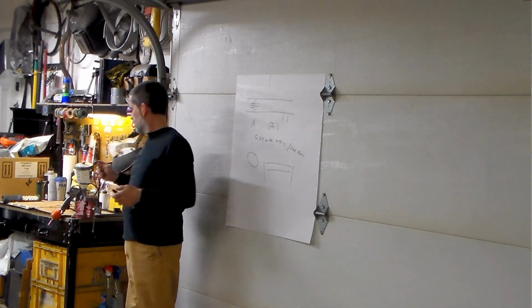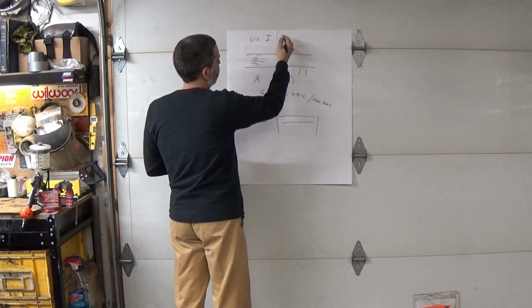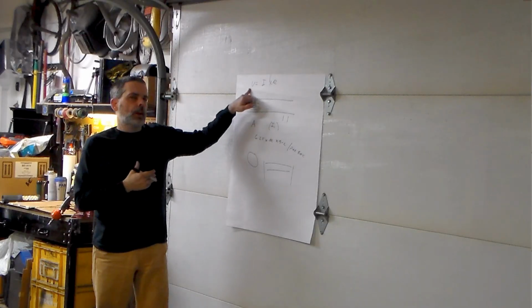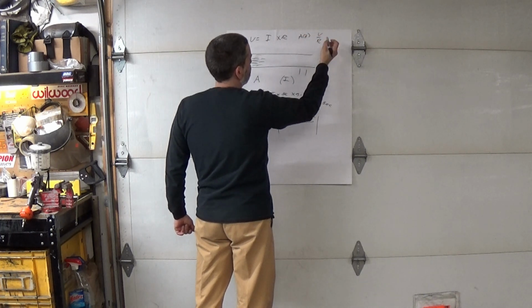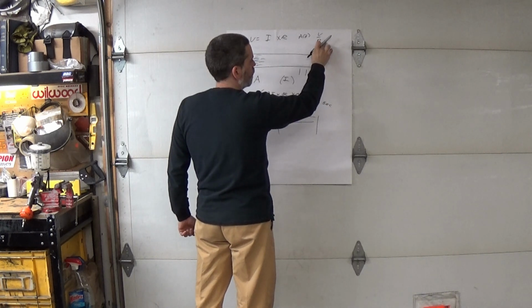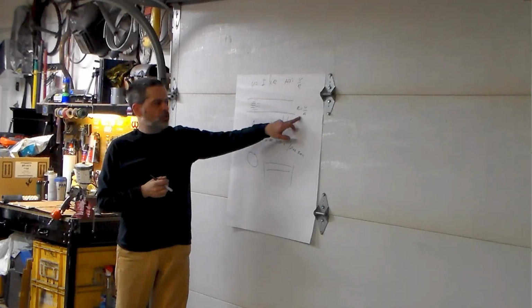larger gauge of wire. We can relate all this to Ohm's law, which is voltage equals the amperage times the resistance at which it overcomes. So one is always dependent on the other. So the amperage, or I, is equal to V over R, the available voltage over the resistance in the circuit, and then the resistance is actually dependent on the voltage over the amps. So they all have a direct relationship to one another.